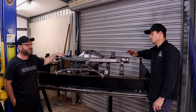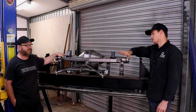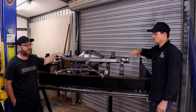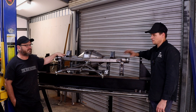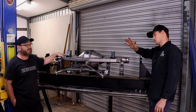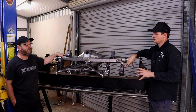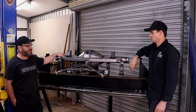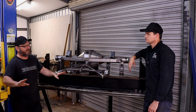There's plenty of people out there who don't run them, but you'll see a lot of cars twist off when they leave. When I put them in cars, it creates a really consistent car, and you eliminate a lot of twist. You can actually eliminate tyres spinning on rims by preloading certain sides. And so it's keeping the diff planted, both tyres doing as close to equal work as possible.